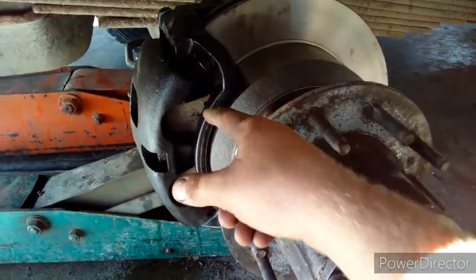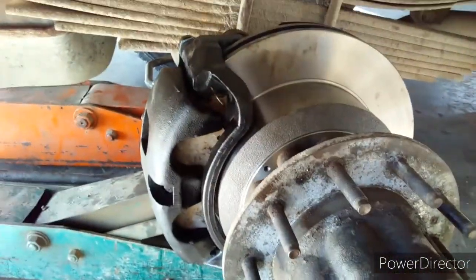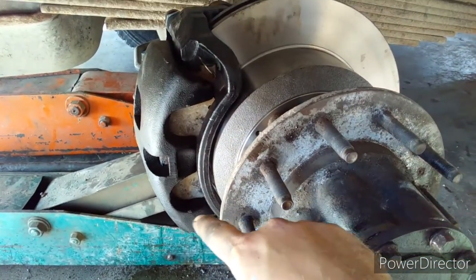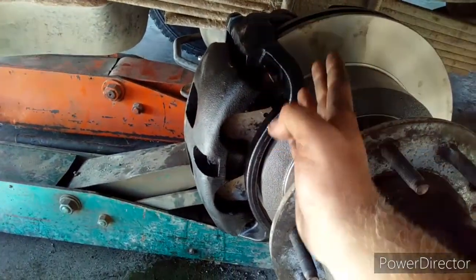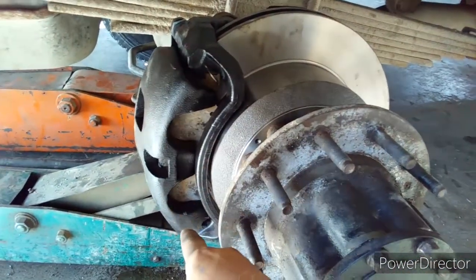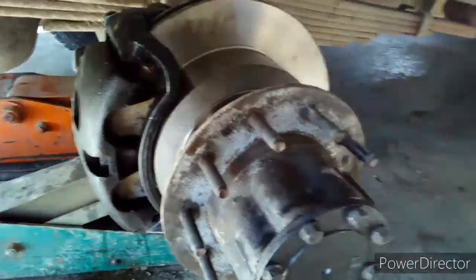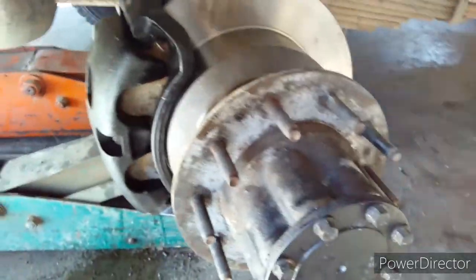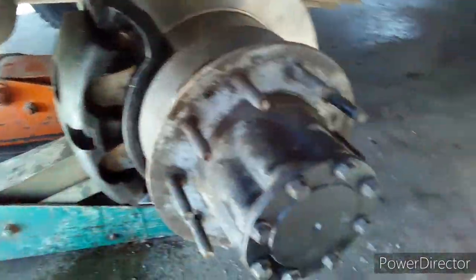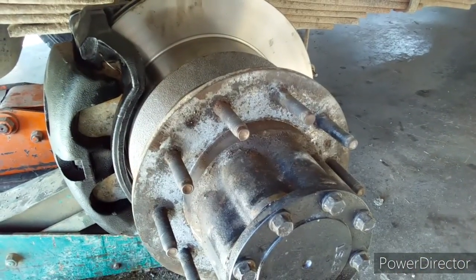Got it all together — we got the axle put back in, the caliper on, the brake pads on, got it all tightened up, and bleeded the brakes with the bleeder, which is that little silver piece back there. One thing to note: on smaller trucks you can just take the top bolt out and pull the caliper down to take the rotor off, but on these bigger trucks you cannot. So that all came back off, we put the rotor on, and then that went back on. We put sealant around there to make sure it doesn't leak. Now we're just ready for tires and then we're ready to hit the road.